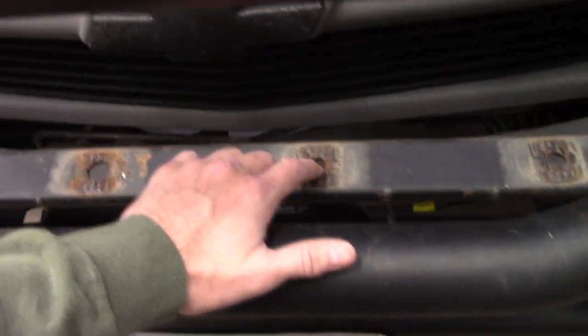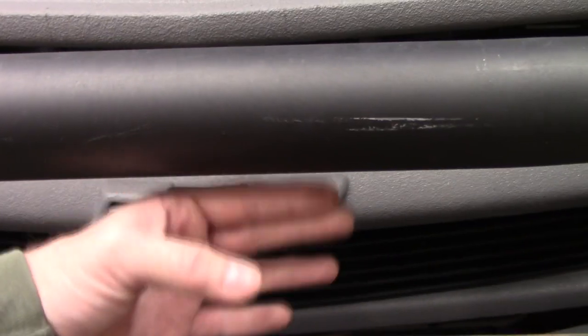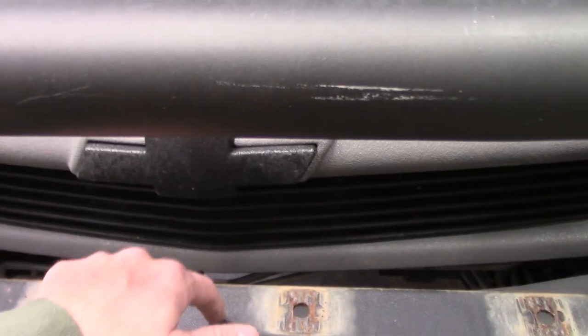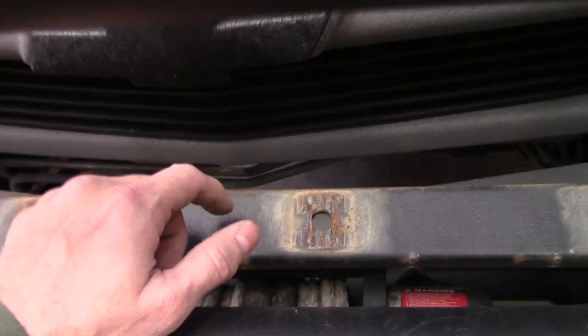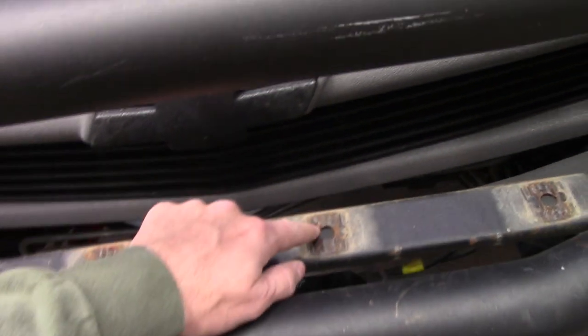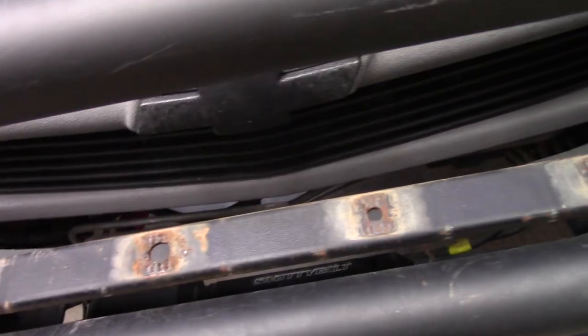but these holes, because everything gets into too much interference here, maybe if I'd have dropped it like an eighth of an inch, if this bar had been an eighth of an inch down, it may have been a decent enough solution, but those welds are solid enough that I'm not tearing any of this apart. So the other option is lengthen these holes. So let's get to that.